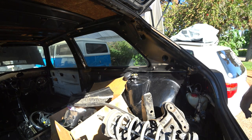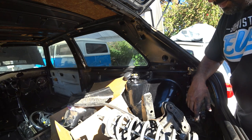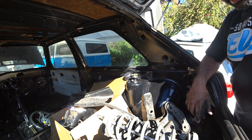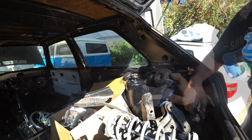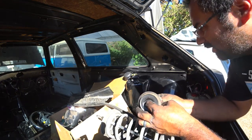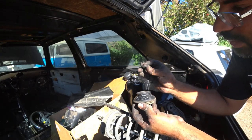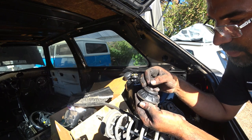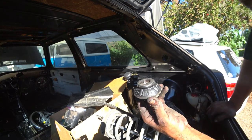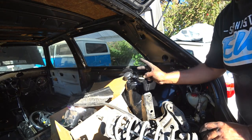Thanks for watching this episode on rear suspension removal. The next DIY will be removing the rear calipers, rear spindles, and the rear beam as well because all this is coming apart so we can get everything refreshed. Wait — before we forget, underneath there's another bushing. It goes in like this underneath, and it has one of these other little pieces right here that goes in on top. You cram it in and then rebuild the tower of stuff underneath. Just wanted to give you guys a heads up on that too. Peace out, thanks again.